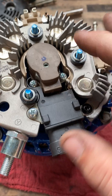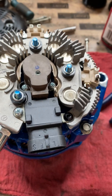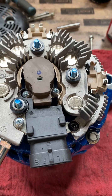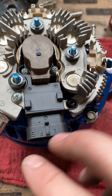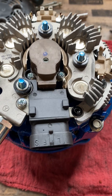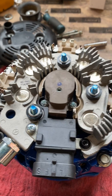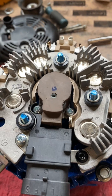The reason people get this done is if they want to charge higher. This regulator is set for 14.8V, whereas the previous one was PCM-controlled and was dropping the customer's alternator down to around 12.6–12.8V. He's running a new Limitless G30, so you generally want to be at 14.8V or higher. I'm going to include two diodes in the harness when I send it back, so it'll charge around 15.3–15.4V, which is a pretty safe voltage for most vehicles. Some cars really don't like 15.6V, hence the disclaimer.